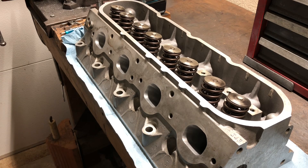The second head — I wanted to go ahead and get this one assembled and check some of the installed heights. These springs are supposed to be set up at 1-inch 810 thousandths. Exhaust valves were 1-inch 810 thousandths and the intake was 1-inch 810 thousandths. That's within your plus or minus variance allowed on valve springs. What we do is clean out the valve guides with a brush, get them lightly lubed, then put in the locators, then the valve seals, and start the assembly process.